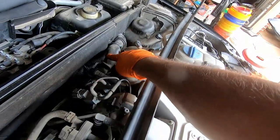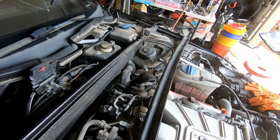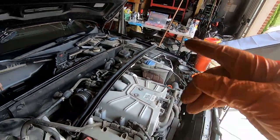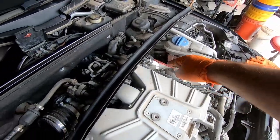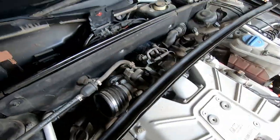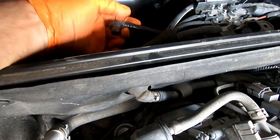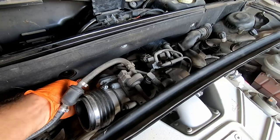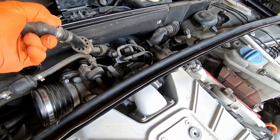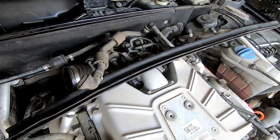On the other side, there is the engine wiring going inside the ECU somewhere there. So I need to refresh my mind how to get to there. We will disconnect those wires, and those wires gonna come down with the engine as well. I also forgot about the vacuum line that goes to the brake booster, and it disconnects from this side. So let me check. All right, now this vacuum line is disconnected. It will remain with the engine.